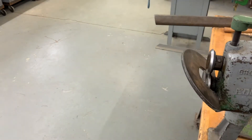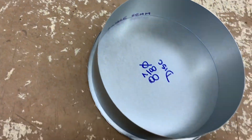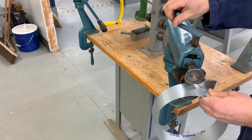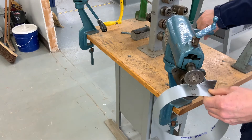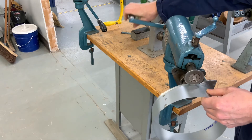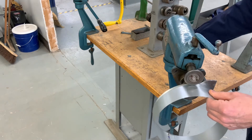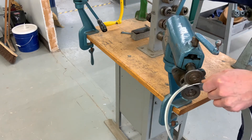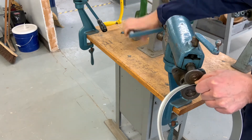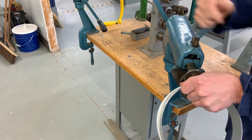So now that that's repaired, I take a quick look to see what gap I have going around the body and the cap. This gives me an idea on how much of a flange I should be turning. In this case I'm going to turn a quarter inch flange, and I like to turn it approximately 75 to 80 degrees — not totally 90 yet.